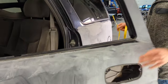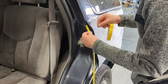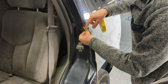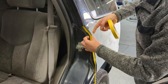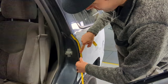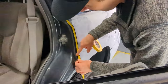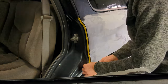You can essentially have a seamless edge on the edge of your panel by taking the side that's folded over with no sticky side on it and running it right up against the edge of where you don't want the paint to go. I usually break it off in a couple pieces when doing a compound curve like this — it doesn't bend very nice. If you bend it, it'll pull away from the panel and you'll have a high edge and it'll lift off, which defeats the purpose. You just run it along your seams like that, do another tear, and do this last little section.